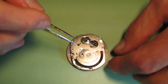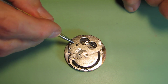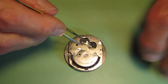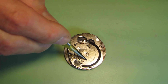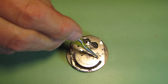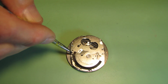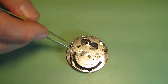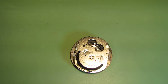So this is a big metal part which holds the mechanical stuff and covers the movement. The video on YouTube that I found about replacing the battery in this watch suggests removing this wheel, this mechanical part, and then unscrewing the screws here. So 1, 2, 3, 4 screws for the mechanical part to remove. Then I think 6 screws around this plate, and then this plate will go up, and they suggest to remove the battery.